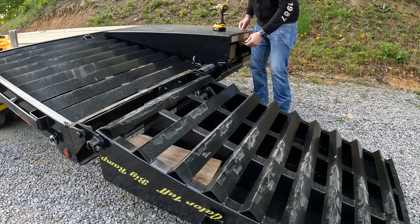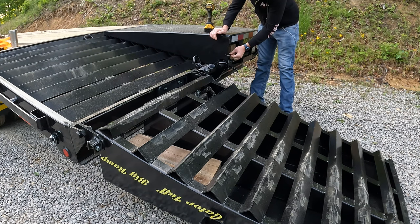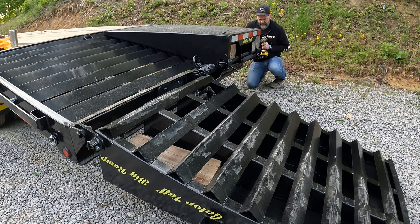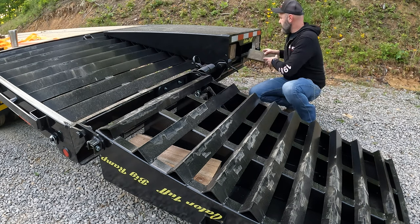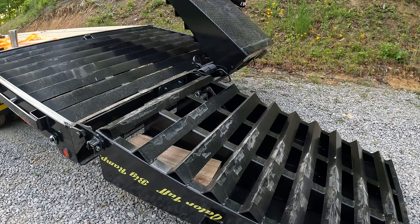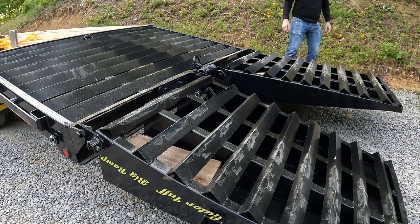It fits, but I might want to make it just the next size bigger. It lays a little better with that one, so we'll drill the 3/8ths. The 3/8ths actually fits the straps anyway, so just in case they ever need to do that again. You can see that block of wood could come out and cause the ramp to get hung, so yeah, it needs this.